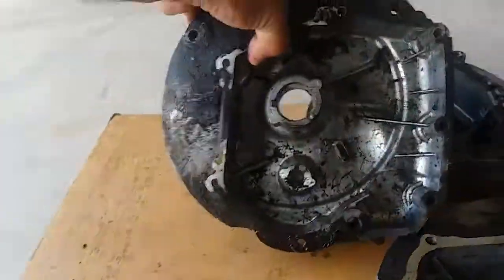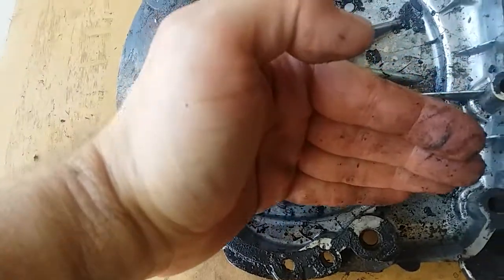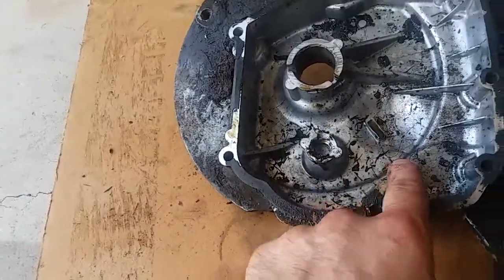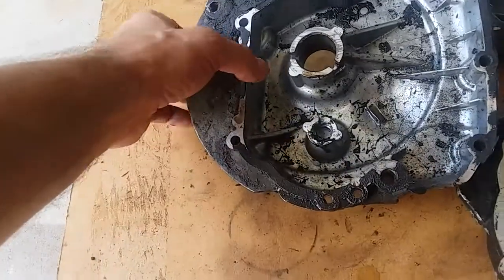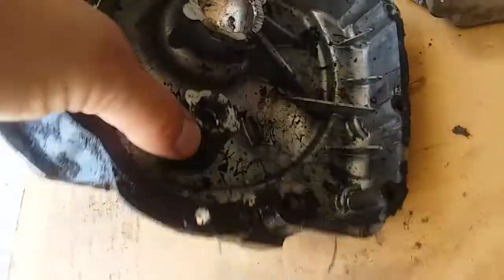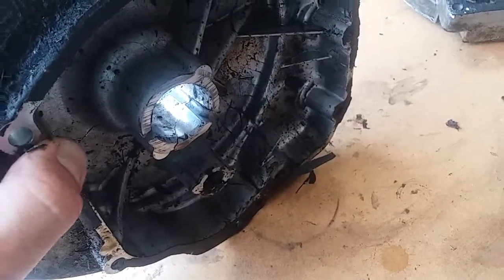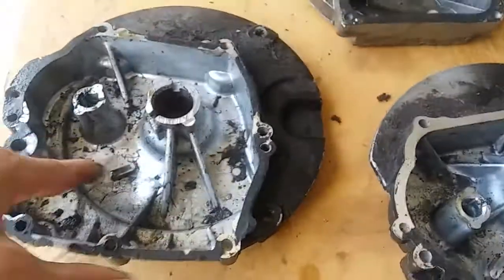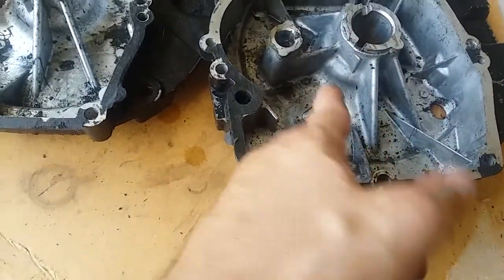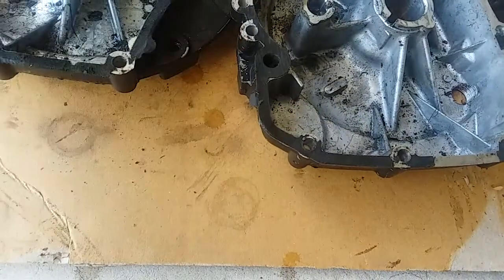Now one thing of note, let's just say this is in this direction, so the oil level keeps dropping and comes out here, there could be oil that remains back in here. So what I do is dump it over, then once it stops dripping, I put the mower back down, lift it up this way, so the oil comes out of this area down to the bottom, and then lift it up like that. Try to get that remaining amount out. So what I'm really saying is there may be an ounce left behind in here, whether you do it this way. If you pull this plug, you may have an ounce or two left, but by tipping it up, you're getting a lot of this sludge and everything to move down and flow out.